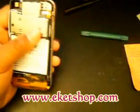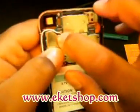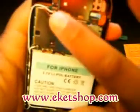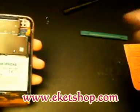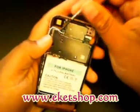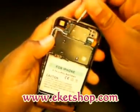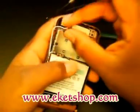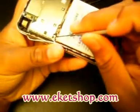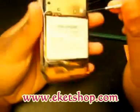Now there are two antenna connectors — one right there, one right there. You're going to get a small screwdriver and take those off very carefully. You could damage your phone if you don't do this carefully. They will be held on by glue, so it might take a while, but you'll get there. Same thing with the other one.